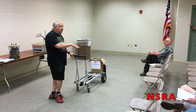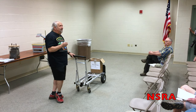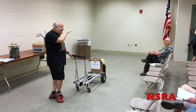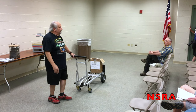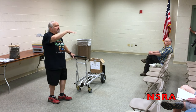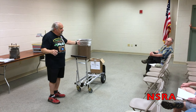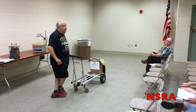So if you've had a problem with that hydrogen gas, there's no solution really, because it's still going to be attracted, other than keeping the level up high and keeping the dang battery vented. Never, ever put a blanket or something over the top of the battery in storage. Kiss of death. You want ventilation, and if you've got a battery like that and you're going to store it, leave the hood up a few inches. Let it breathe, because you'll have a lot less hydrogen sulfur.